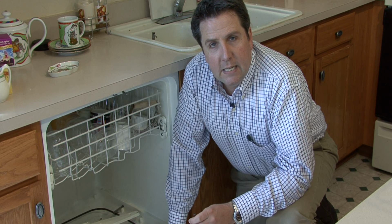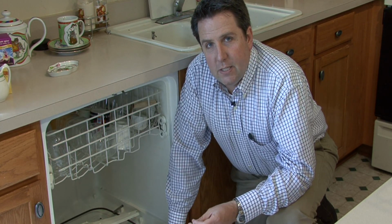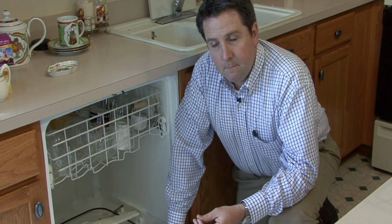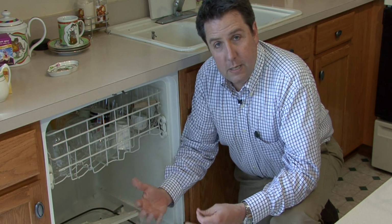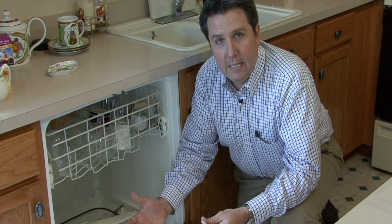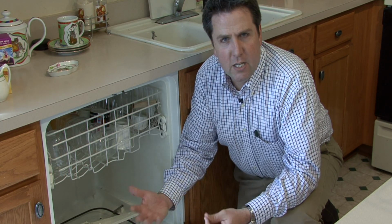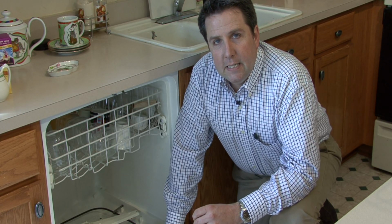And the last thing for really simple troubleshooting, many manufacturers of dishwashing detergent and dishwashing liquids these days have a super concentrate that you put in the basket that holds your silverware and run the dishwasher empty on high heat on a pot scrubber setting, and it'll clean all the internal mechanisms. It'll work good on any food buildup, any gum buildup, that type of thing, and your dishwasher should be working a lot better after that cycle's finished.